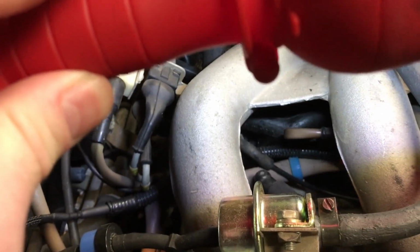So I was planning to do a smoke test or some sort of vacuum test, pressurize the intake, and see if I could find where the leak was. But I actually was able to see the leak. It turns out that one of the vacuum hoses underneath the intake manifold, the super fancy one that if you were to buy from Porsche costs $536, I think it is, which is insane for a rubber hose. Yeah, that hose on my motor is cracked.